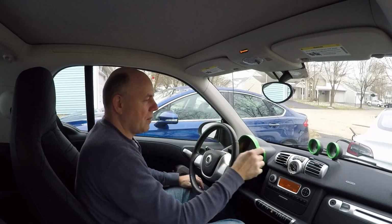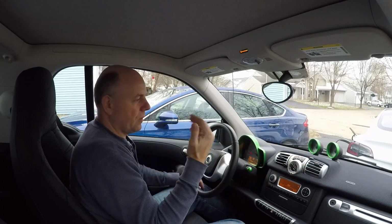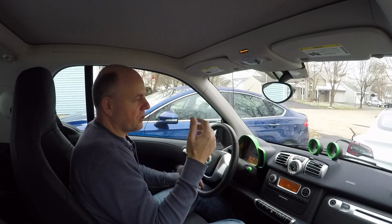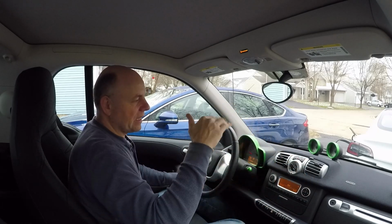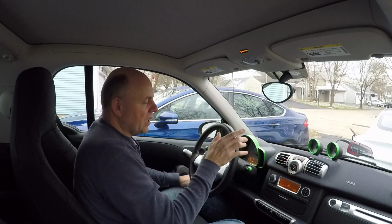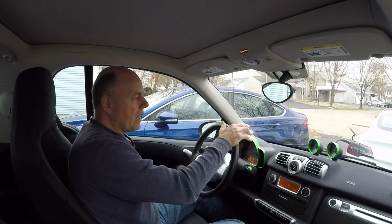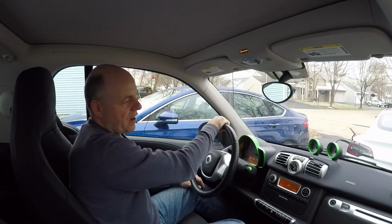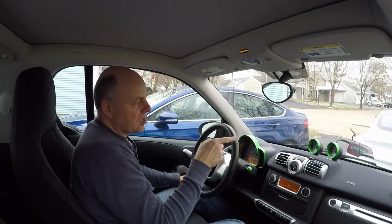The information's probably out there on the web, but it's probably just cranking up to 82 or whatever degrees and then regulating there. So it probably used a huge amount of power for 20 minutes or whatever, warming up the car, and then was probably cycling the heat on and off to regulate at 80 some degrees in the car. But anyway, worst case scenario, if you have the heat as hot as possible in 1 hour, cranked full blast, in this particular car, you'll lose 25% of your state of charge. And it's good information to know. Now, that's the worst case scenario.